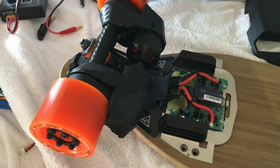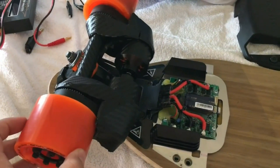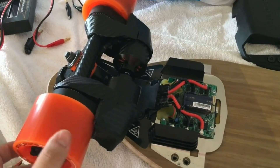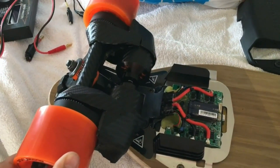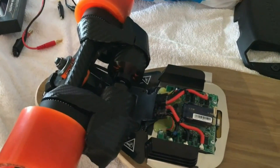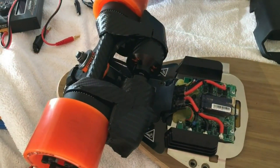The boosted board has a 3.5 gear ratio in comparison. The Inertion setup would have a 2.5 with a 63 millimetre motor, while the boosted has a 50. So they're compensating the amount of torque they can produce with these motors with the higher gear ratio. These motor KVs are a lower KV — 190 KV — which would be the same as the R-spec motor from Inertion. But a 60 millimetre motor will have a naturally lower KV because of the larger stator and larger motor can.